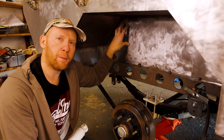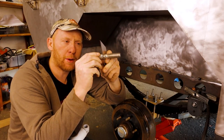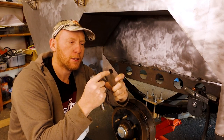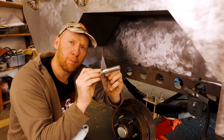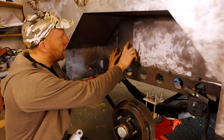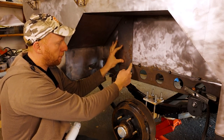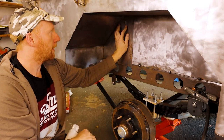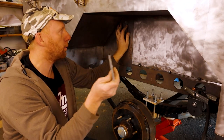Seeing as this is where I'm going to be mounting the shock, what I'm worried about is the contact area where it sits here. If you've got constant vibration and movement, you might start making the hole bigger little by little as it reams it out. So by stacking a couple of sheets at the top, all I'm doing is making it thicker just on the shoulder area where the bolt would sit. I'm going to weld this plate in — you can see I've had all the corners laser cut. I've made it a little bit longer to give it some extra strength across the whole section and to weld it at the bottom of the frame so it attaches straight to the frame. Then this piece goes on top, and in total on the backside I would have six millimeters of steel supporting the bolt, with another six millimeter plate going on the other side.